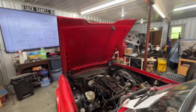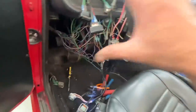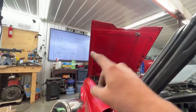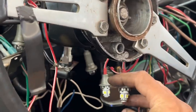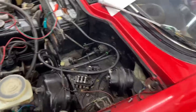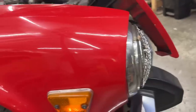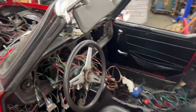This part of the circuit is okay. I just want to make sure that everything in the front here works. Now we can put the red fuse in for the red circuit so we can see if the dash lights and marker lights are gonna work. One fuse in, and the marker lights — I went just one click down — now they all work in the front, even though it's a mess with the wiring. The rear ones don't work yet because they're not connected — we'll deal with that later.